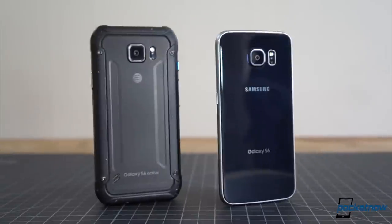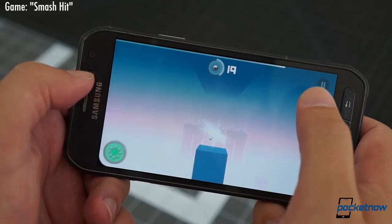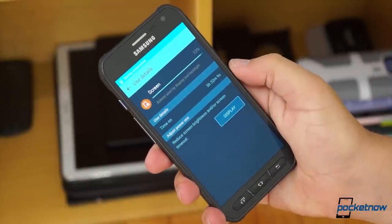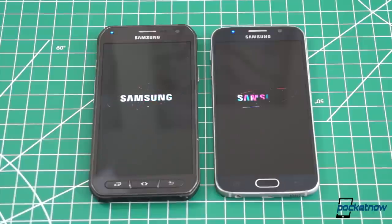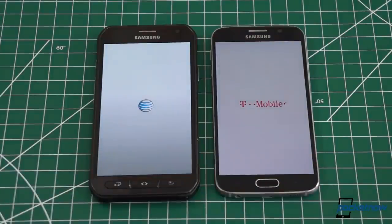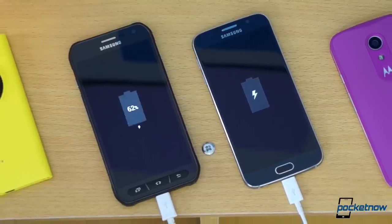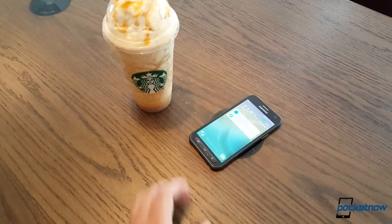The final component change is the biggest one: the embedded battery. The Galaxy S6 Active ups the capacity by an impressive 37% over the standard S6, which makes a huge difference in day-to-day endurance. While it's always a struggle to get even four hours of screen-on time from the stock S6, the S6 Active delivered five and a half hours of screen-on time over 13 hours off the charger on our first day, with heavy use of the battery-intensive game Ingress. Just keep in mind it also takes slightly longer to charge, even with the adaptive fast charger included in the box. If you want to charge wirelessly, both Qi and PMA are supported, just like the standard S6.